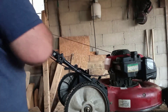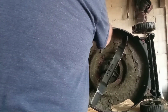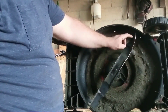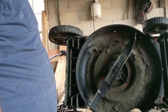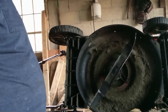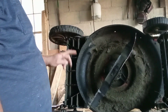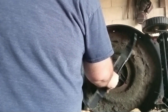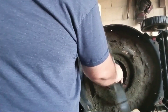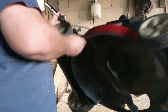I'm gonna try to get this thing rolled over so you guys can see what's happening in here. Flip the motor up on its side. She's whammied real hard right there. So when I get a mower that's hit something, the first thing I like to do is flip it over and look underneath, see how damaged it is. Let's see if we can spin this thing, see if we can hear if the valves are opening and closing and the piston's moving. Because if it just freewheels, the crank's probably snapped and it's done. Alright, you hear that squeak noise? That sounds like compression. Alright cool, let's go ahead and flip it back up. We'll take that blade off in a minute, I want to check something else first.